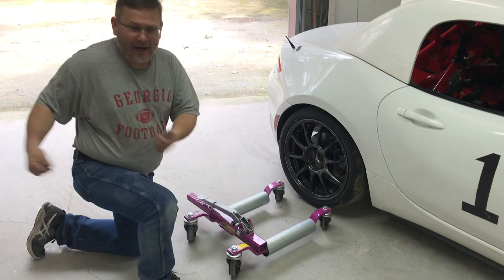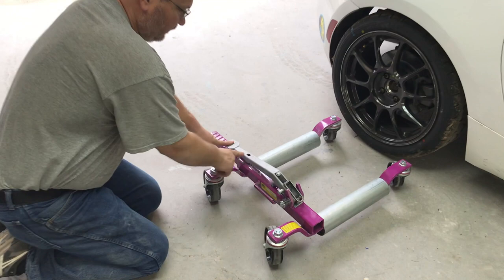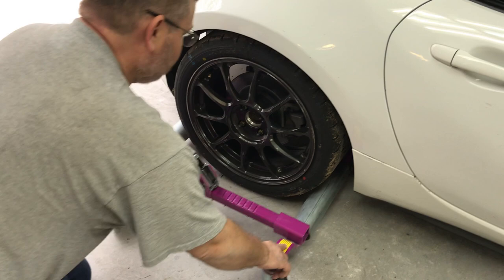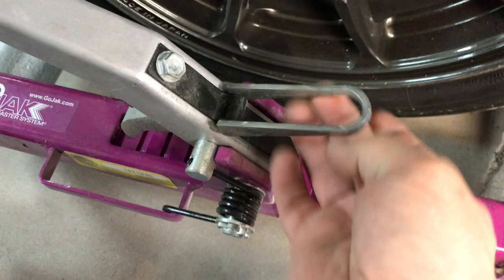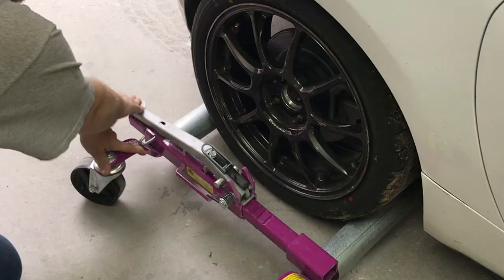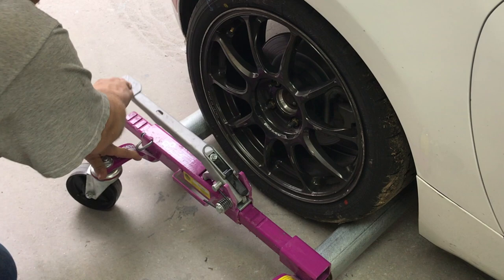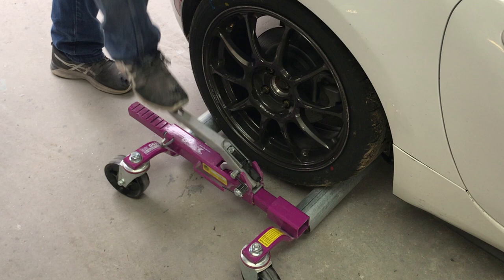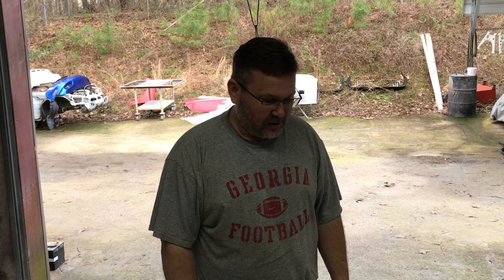Basically you lift it off the rack, come over to the car — it's locked in with this little hook, so you push down and flip the little lock out of the way, letting it up which releases it so you can slide it apart. Slide it as wide as you need to get around the wheels and tires, slide under the car as far as you can, then slide it together. Flip this little switch to engage the locking mechanism, which pulls the two sides together and raises the tire off the ground. You can do it by hand but it's made for doing by foot. Once it's locked down, flip this little lever to block it — now the tire's off the ground and it'll roll wherever you want.